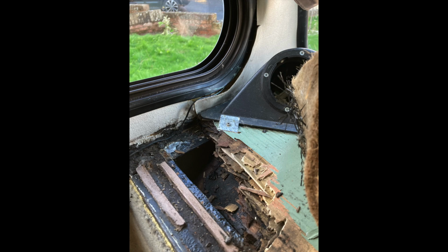So onto the roof repair. First thing is you pull out the Adhesive strip, which is the plastic strip on top of the aluminium roof rail. And you'll see this reveals some rusty screws. These are the classic culprit. They're not stainless, so over 30 years they've rusted away, disintegrated and left minute holes for water to run down through into. And they also won't be holding the roof to the sidewall of the van any longer, and you'll see why that matters in a minute.